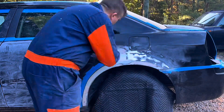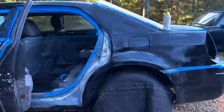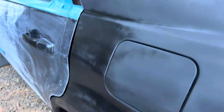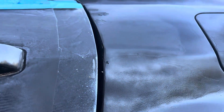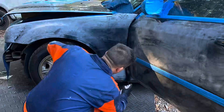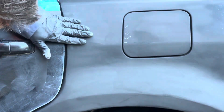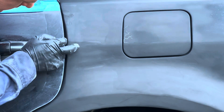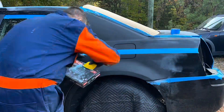I'm getting ready to apply this black primer here so I can actually see what's going on. Once I apply it everywhere, I look and I'm like — uh-oh, look at that, that's messed up right there, so I really need to fix this. I actually waited for it to dry and started working on other areas. Then I came back and could see there's a reaction on my gas cap — that's because some old primer has stayed. When I opened up the door, there's some reactions on the inside as well.